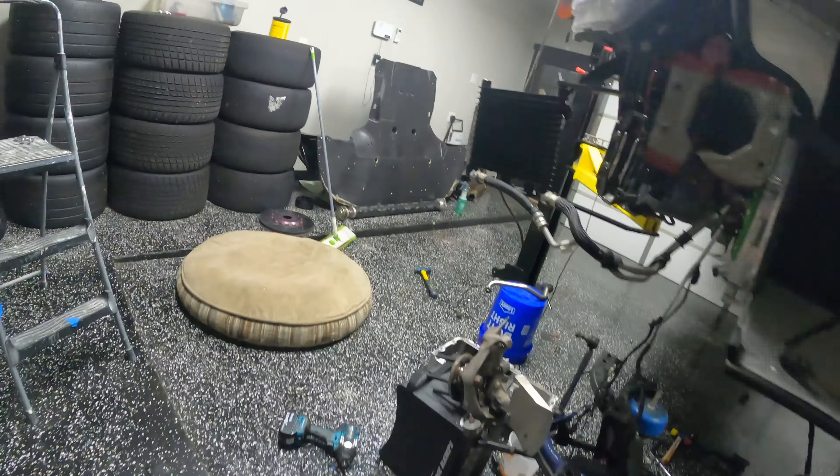I was really excited for this brand new super lightweight racing clutch. It's red Loctited in because this engine vibrates everything loose — point in case. I really didn't want a high-RPM clutch coming out, especially now that it doesn't have the dual mass that the OEM one did. So I red Loctited it in — that's what Spec recommends. Great idea. Damn it. So we're going to have to pull that out and pull the engine out.